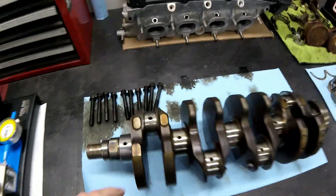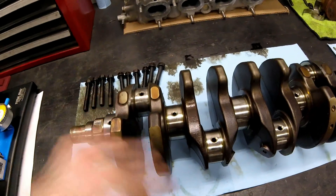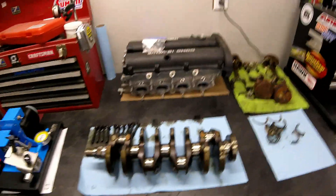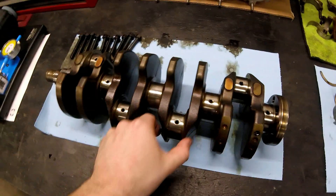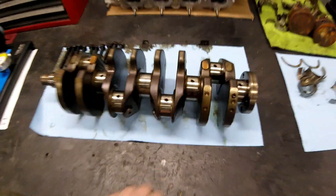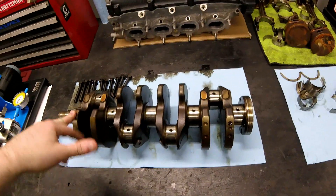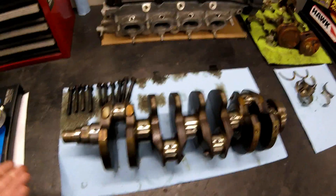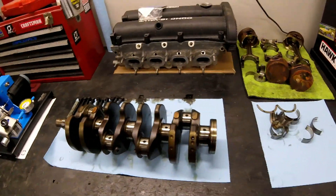What to look for on a crank: the journals can be repolished or turned undersized if needed. On all of the rod journals, check to make sure there's no major discoloration. If the motor had a spun rod bearing, these areas of the crank will sometimes turn blue or gold from the extra heat they experienced, and that could be a symptom of a damaged crankshaft. This one looks in wonderful condition. I don't know the history of this motor, but it turned over, all the pieces were in it, and it does not appear to have been taken off the road for a bottom-end failure — everything looks fine and ready to go.